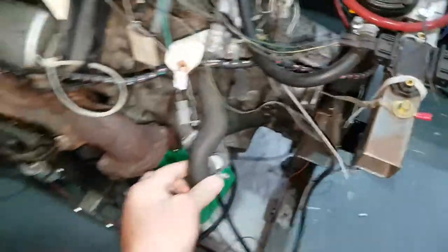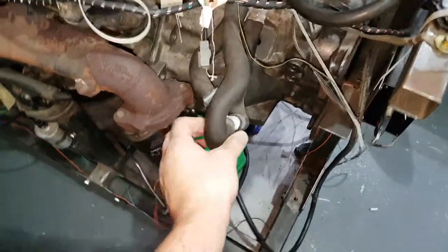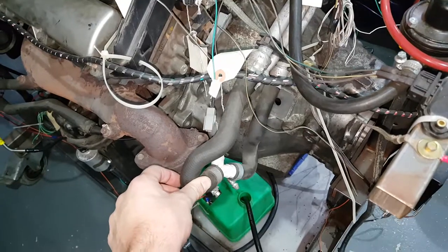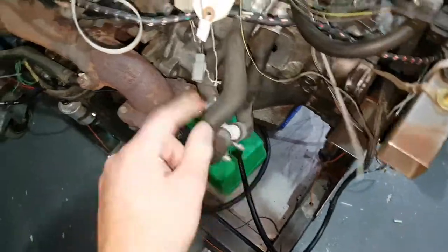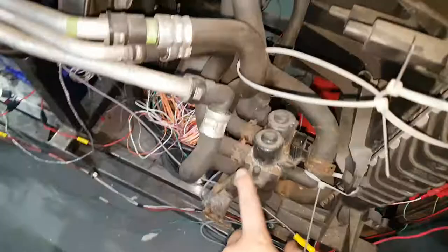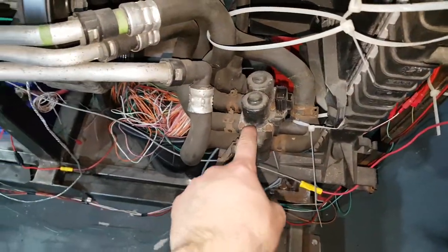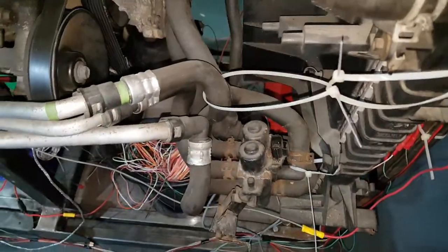The cooling system — we've kept all original hoses from the Jag. We've had to bodge the climate control heater pipes. For some reason there are three pipes that go to the heater in the cabin, and we've just put a wide connector there to blank them all off for now. There's a mechanism down here that's got some solenoid valves that control hot and cold water going into the cabin heater — we'll cut all this out and block off the pipes when it goes in the car.